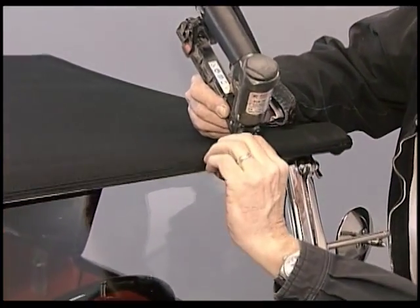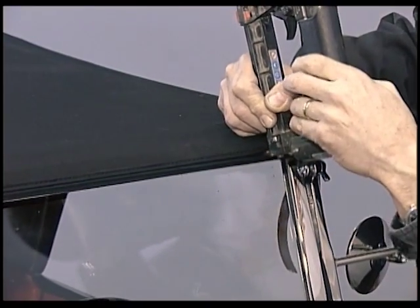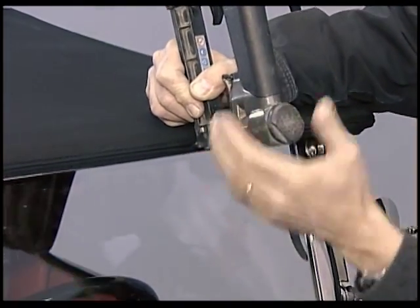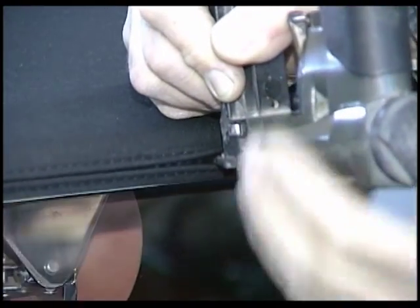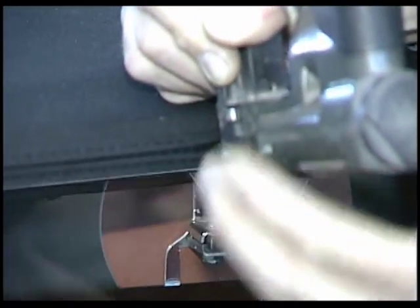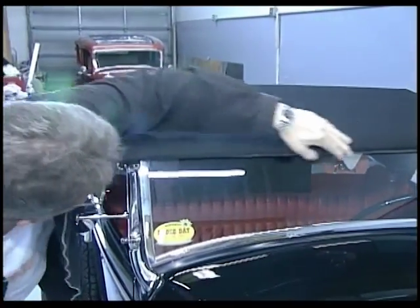Open up the hide-em, get your staple gun started inside, and then it just slides inside there. Just go a little bit at a time, make sure the bottom stays level. There's no hurry on this first installation — you may be in a hurry, stuck out in the rain wanting to put your top on, but take the time here and install it properly. Check as you go all the way, making sure your bottom edge stays perfect with the bottom of the header bow.